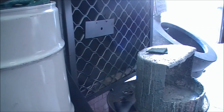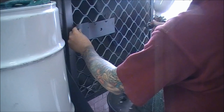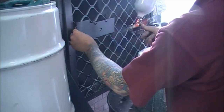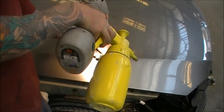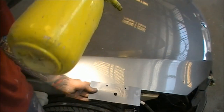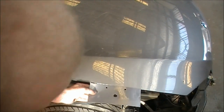When doing this color card I'm going to cover up a small section of the card just so I can see how much it's actually changed. Over at the car I can say: this is how much I put in, this is how much it changed — is it going in the right direction? You can see there's a line down there so you can make a good judgment on whether or not it's changing correctly. I think it is going in the right direction but it's still looking a little bit too blue, so I'll go back and put the same color in again — about the same amount of those two tinters, which is yellow and red.